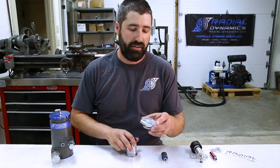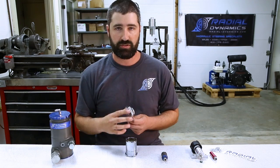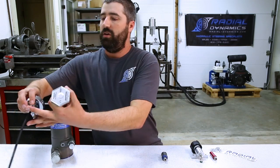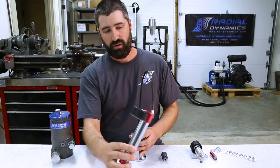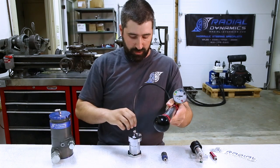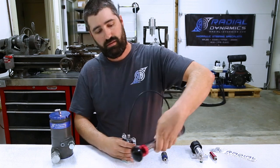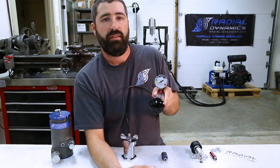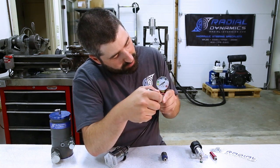The first thing we're going to look at is a radiator cap. This is a Moroso 8 to 10 psi cap, and this is the same one I've been using on the vortex reservoir up until recently — all of the first generation reservoirs use this or an equivalent pressure cap. If I pull out my coolant system tester, which has an adapter to test radiator caps, I can go ahead and pressurize this. We can see it doesn't hold very much. If I push it very quickly, the needle jumps up and it's a little bit closer to that 8 to 10 psi, which is what this cap is rated for.